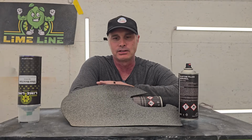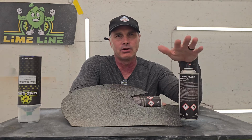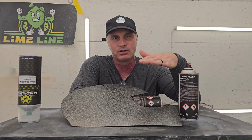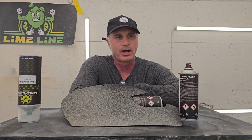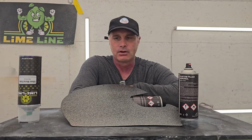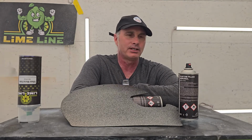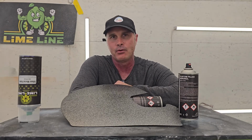As you can see, you'll do the same thing you do with any base coat. You'll do a flash time. Either set your timer 5-10 minutes, or you can just watch it. When it goes from glossy to dull, that's when you can apply your next coat. So yeah, all right. Well, there's my review. My final decision on this is A++. It's a must-have when this comes out.